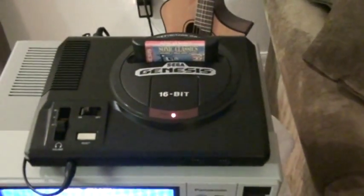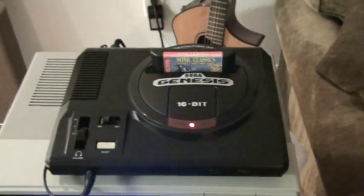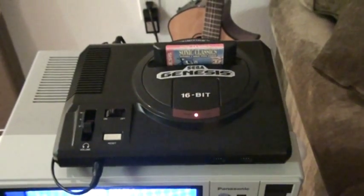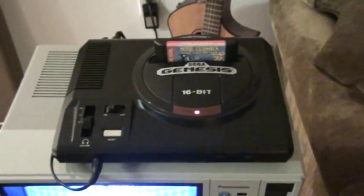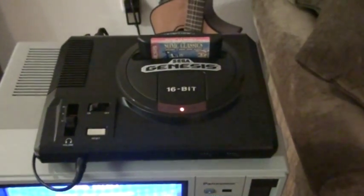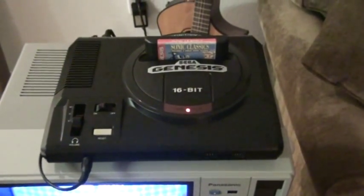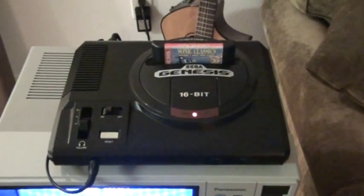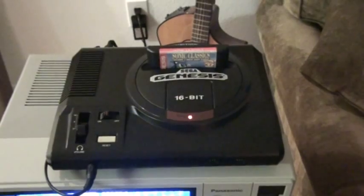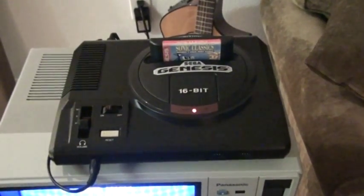So, guys, I hope this video is useful for anybody that's encountered this problem. I don't really know how you'll stumble upon it, but if you are playing on a Sega Genesis Model 1, Model 2, whatever, Super Nintendo, NES, and the sound effects and music are coming through but you get this really loud hum, it's probably the power source, from everything I've read. So don't think you've got a bad chip. If it was a bad chip, you wouldn't be getting music, or you'd be getting crackling.